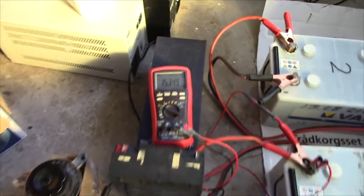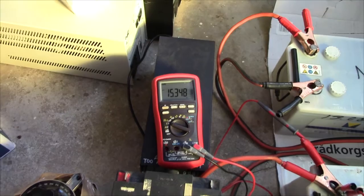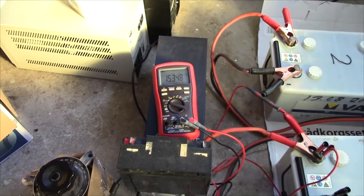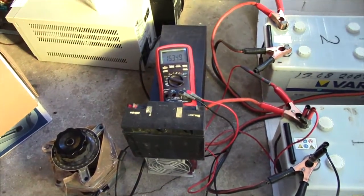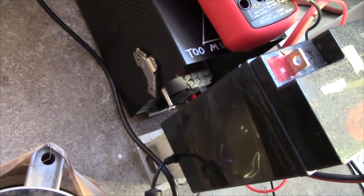I'm just going to leave them to overcharge for a while. I've got the timer set for one hour and the charger set for maybe 20 to 25 amps. I've got a very big fan blowing at it to cool the transformer, just so that it doesn't get any hotter than it needs to - although it does make reading the current meter kind of difficult. And just to be safe, very good ventilation.